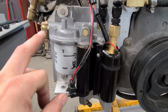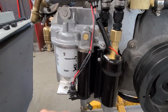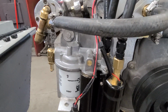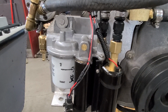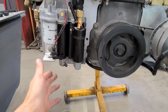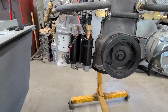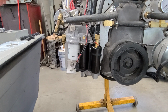So I got these two castings off and completely stripped them of everything. On the inside, there's a float assembly and a few other things you have to take off to get these things down to just aluminum, just metal components. And I went and bought your standard aircraft stripper over at the Ace Hardware. I put some on this piece, did a test spot, and let it sit for 15-20 minutes. I came back and it didn't touch that coating. It did not do a thing to that coating. It wiped right back off.